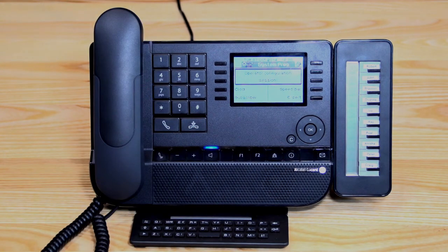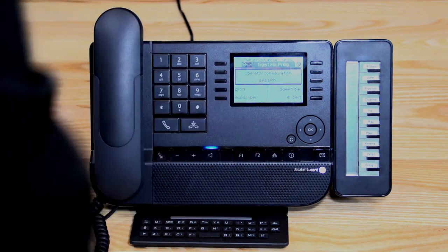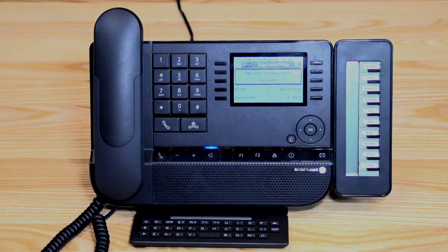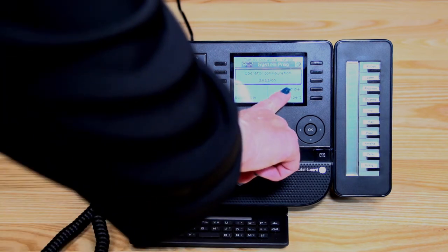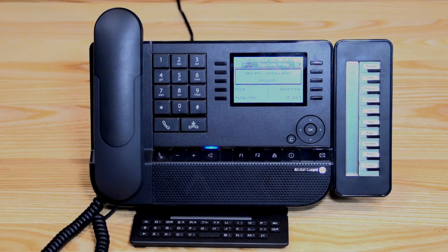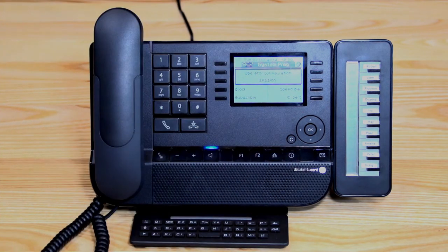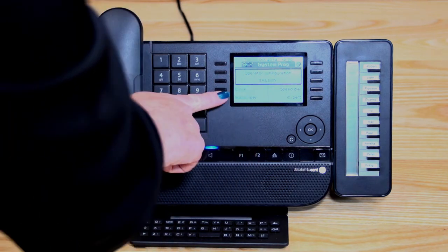Okay, there's a few things that we can do in here. We can change the time. We can go into subscriber. Now that's going to be used to rename phones that appear on the screen, or reset people's passcodes if they forget their voicemail PIN number. We can go in and we can load in new speed dials. And the last thing that we can do, which I'll take you through at the end of the session, is we can go in and record auto attendant greetings. Okay, so firstly we're going to go into the clock.